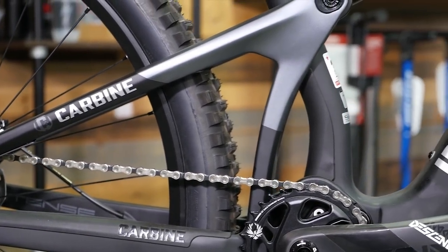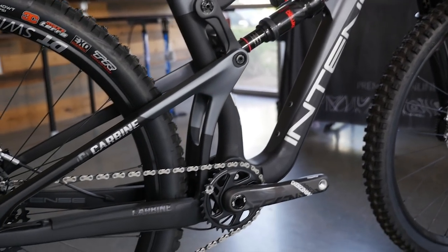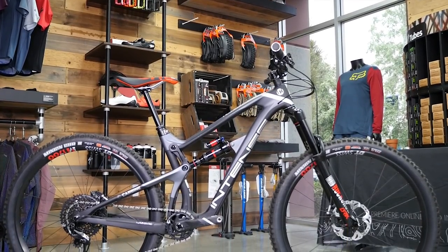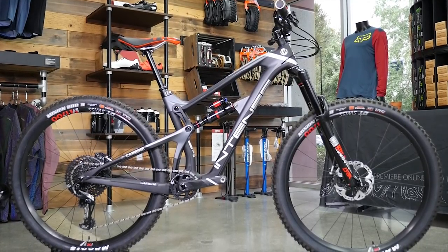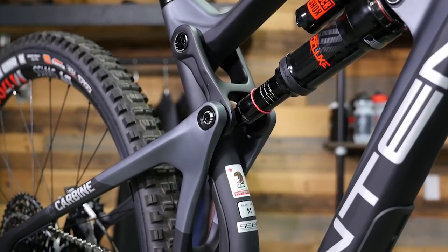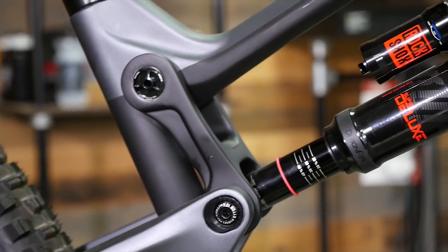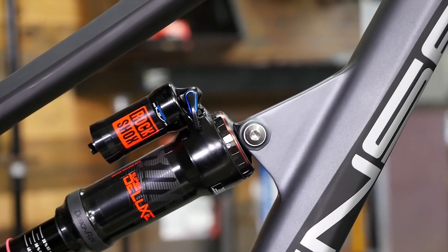The amount of rear wheel travel fits in nicely between a Santa Cruz Hightower LT and their Megatower, and that's a really great place to be. Riding it, I came back and said this is a lot more like the Hightower LT — it still has that playful, nimble feel in spite of having a little bit more travel. That's because Jeff Stieber designed this bike using JS Tune Suspension, a variant of VPP or Virtual Pivot Point Suspension, with a lot more anti-squat built in. You still have good support in the mid-stroke, so it pedals really well and doesn't wallow. It just makes it feel more lively, a little more poppy — it doesn't have that dead, planted feel in spite of being a big bike with big capability.